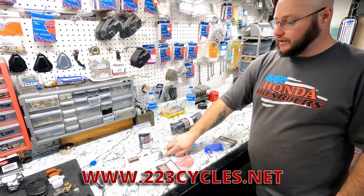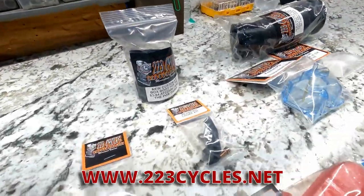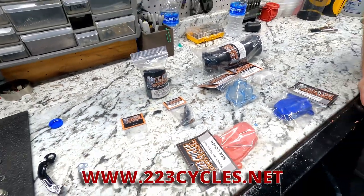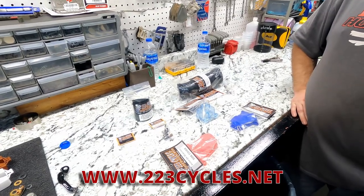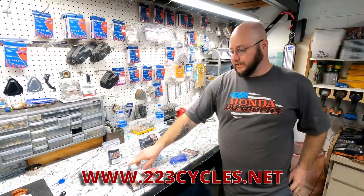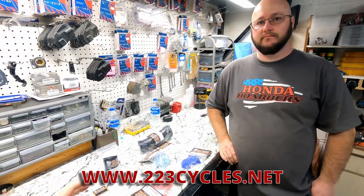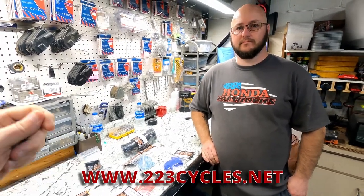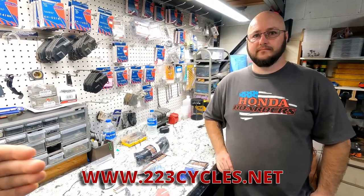Brand new choke lever kit for all your ATC 185, 200 carbs. Okay, yep. So pretty much all your hardtails. Yep. And you can even convert if you're tired of messing with a cable choke on, say, your 200E, 200M, 200ES. You can put this kit on it and just do away with that whole thing. Okay, so instead of replacing, because I found many times that the bracket that holds the actual steel cable breaks. Yeah. And so that's a lot harder to find because some of them are part of the dash. Right.